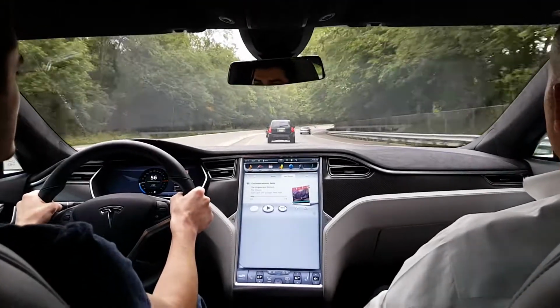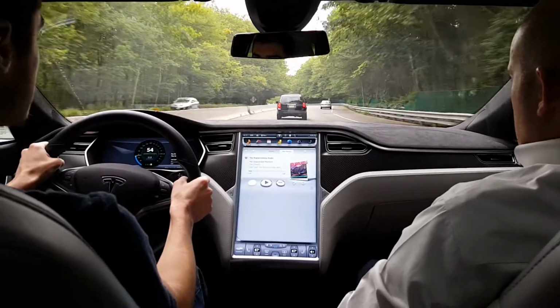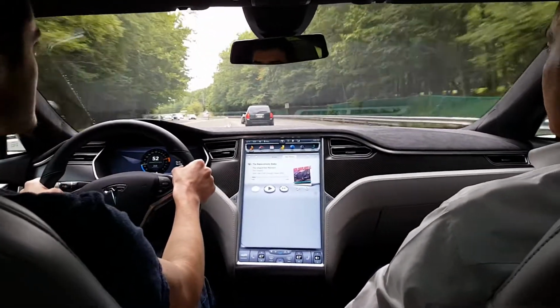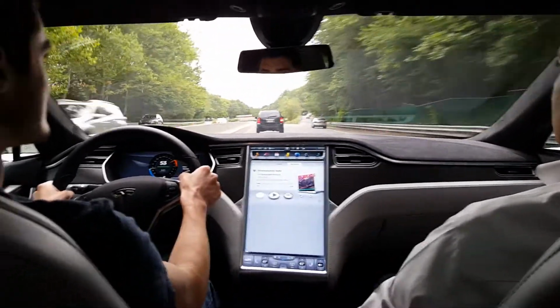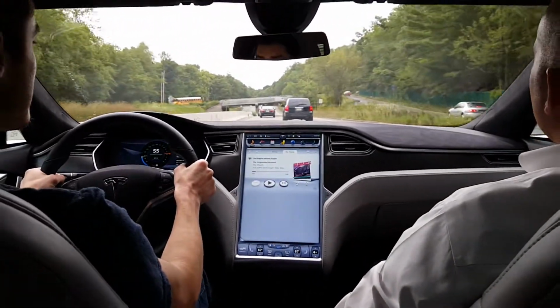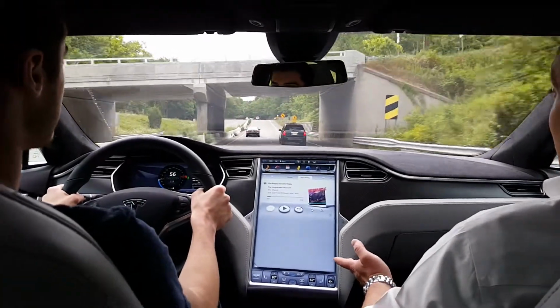A lot of our technicians have found and reported that cars coming in with around 100,000 miles still have 75% or more of their brake pad left. Wow. So the regen braking really helps extend the life of the brake pad, and the car already doesn't need much maintenance.